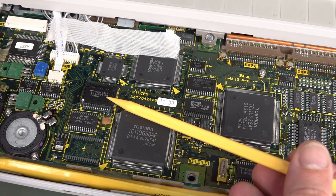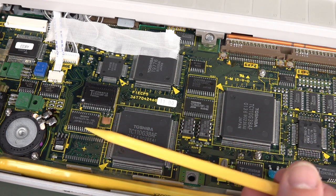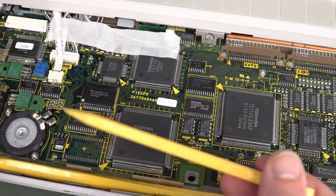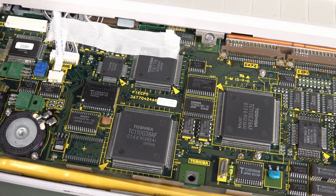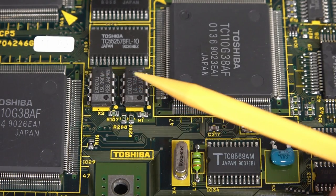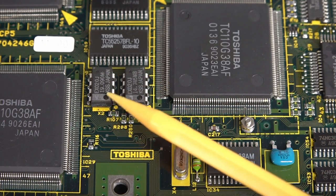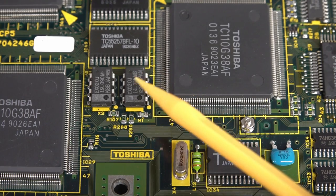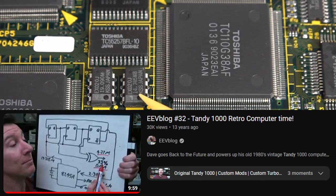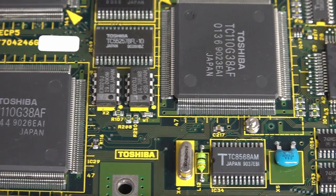This is confirmed to be the BIOS ROM - you could actually change that if you wanted to. This is actually the backup SRAM, and that sub-battery is backing that up. Those two chips I can now see are crystal oscillators: 19MHz and 14.7MHz. I've done a video on my old Tandy 1000 where I designed a turbo board - I'll link that in - and you had to get the correct clock cycles. You can see a third of this board is power supply and miscellaneous housekeeping.